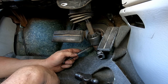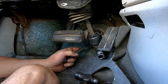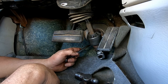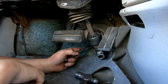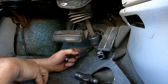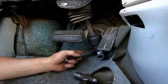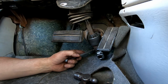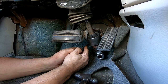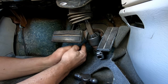Now when you put these back in, this is the best way to do it, to put your lines back on the steering rack. You're not going to be able to thread them in from underneath. This is the second time I've had to change the steering rack in this vehicle, and I learned from the first time that you cannot get these power steering lines to thread into the rack from underneath. If you do, you run the risk of stripping out the threads inside the power steering rack. Because remember, the power steering lines have a galvanized steel fitting on the end, but the steering rack itself is made out of aluminum. So it's very, very easy to strip the threads inside the holes. And once you do that, you void any warranty, and you're stuck with a steering rack that you cannot attach power steering lines to. The best, easiest way to do it is right the way I'm doing it right here.